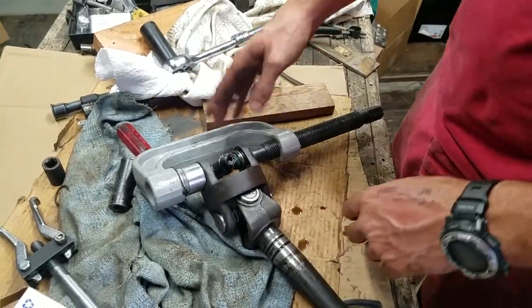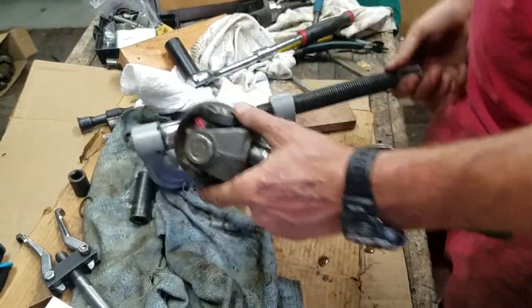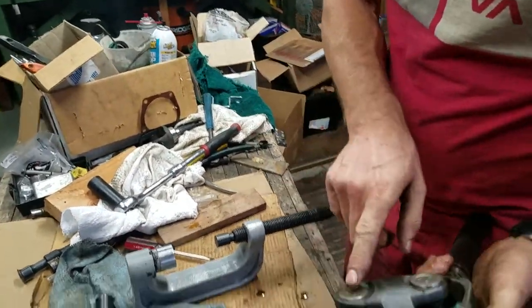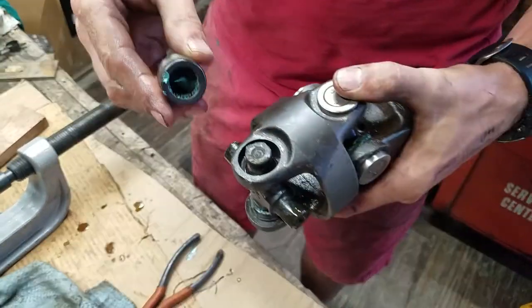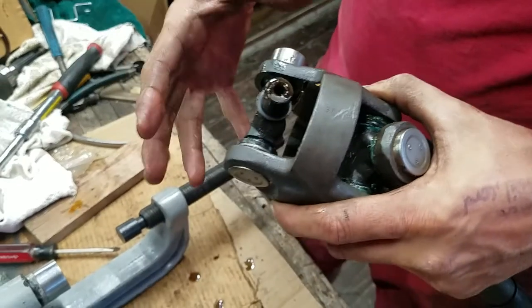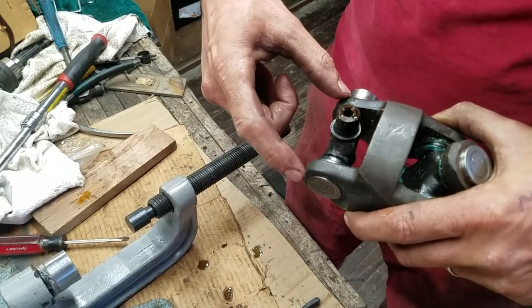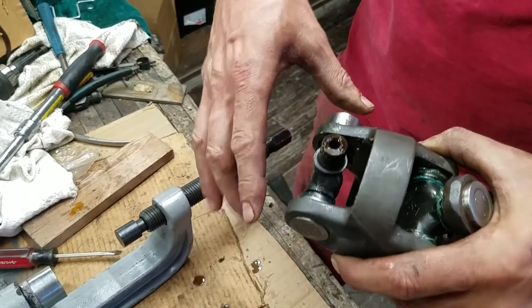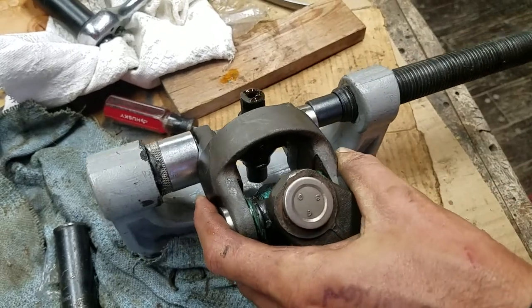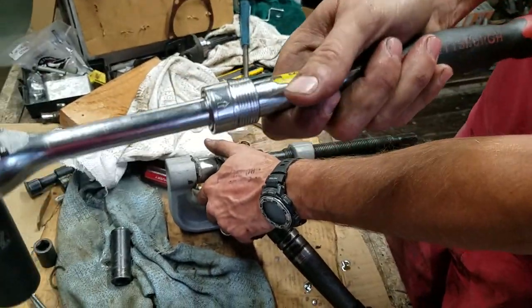Some of you might be saying, why don't you have this in a vise? You can, but then you end up having to manage all the yokes together. I think clamping this on the table would be ideal. We got our first cap in — it's pushed out more than needed. Now for the second cap, you want to anticipate it loading up. When this cap reaches the cross and it's all the way in, you're going to end up pushing both back a little so this ring can snap in. So it is going to load up — just pay attention to what's happening. Don't be tempted to use an impact; do it by hand.